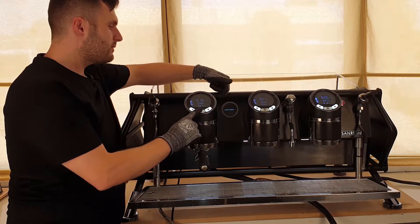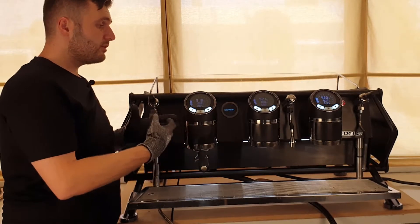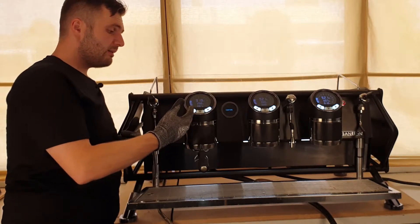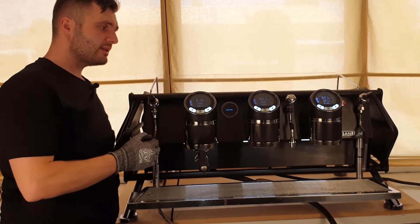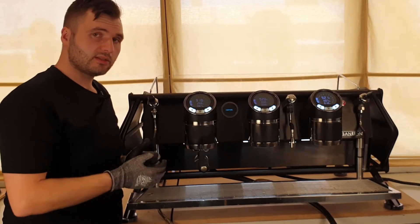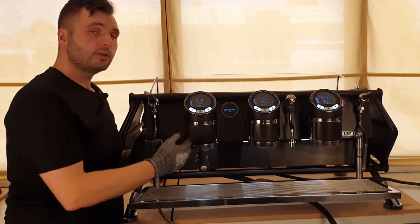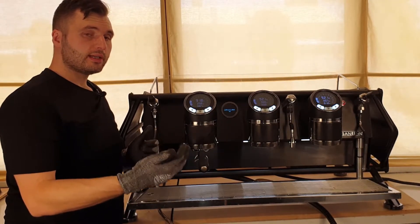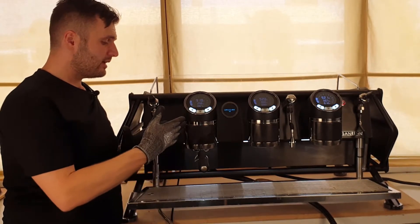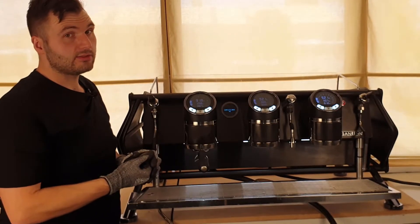In regards to the clock adjust menu, this gives us the ability to program the machine to turn on in the morning, turn off in the evening, and also not turn itself on on the days your cafe is closed. We'll scroll through to the next one — counters. That gives you the ability to know how many times each of your buttons have been pressed. That can be very helpful to make sure you're maintaining even usage of all three heads, because you want to be wearing them as evenly as possible. We'll scroll through to the last one — the complete wash cycle. This activates all three heads and runs them through a wash and rinse cycle, which is like a standard automatic back flush cycle but does all three at once. Unless you have the appropriate handles and blind portafilters for all three, I would not recommend using this cycle.